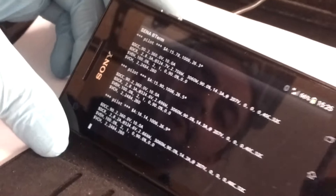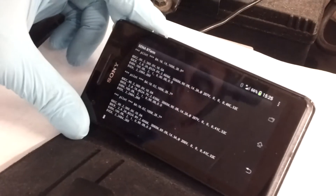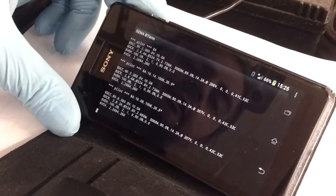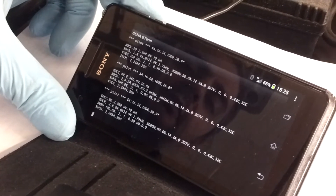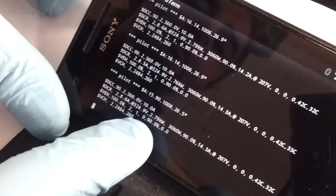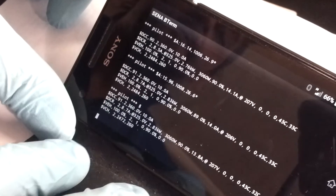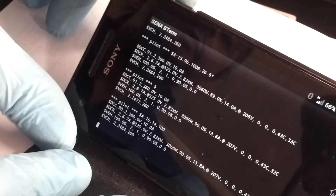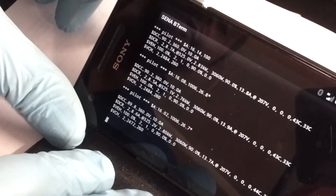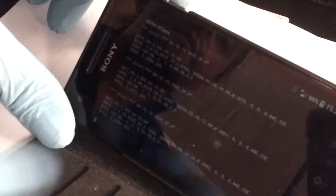This is a simple text display of the parameters from the charger: what commands are sent to the charger, what the car is telling us back, and what kind of power it requires. We can see, for example, that currently the state of charge of the pack is 90%. The virtual charger itself says the state of the charger is 2, and the maximum available power right now is 2.5 kilowatts. These calculations are a bit fuzzy right now but it works.